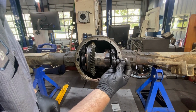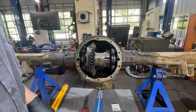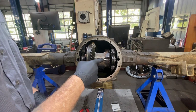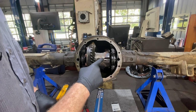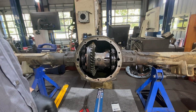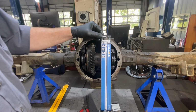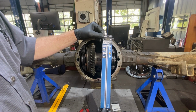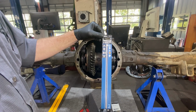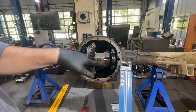What I'm going to do is take this guy and stick it in the hole as far as it'll go. And what that's going to do is, one, center my drill bit, and two, protect the threads that are inside there. Now the drill bits I bought: one, this is a Hercules, a Harbor Freight guy, $3. So it's a gamble. Hopefully it lasts. Hopefully I don't break it off in the bolt.